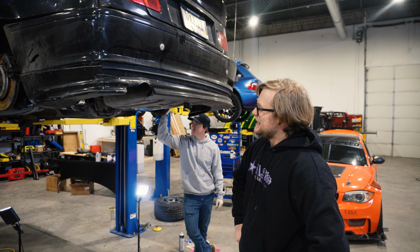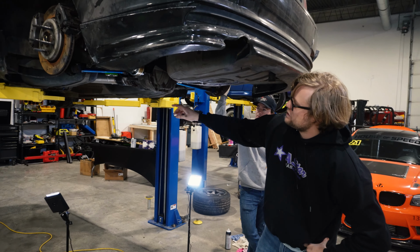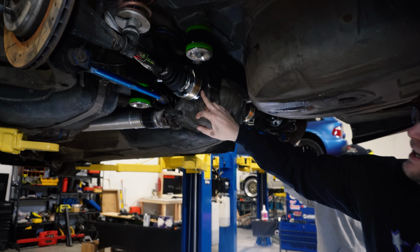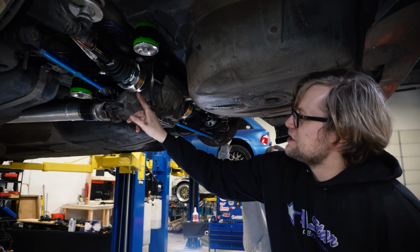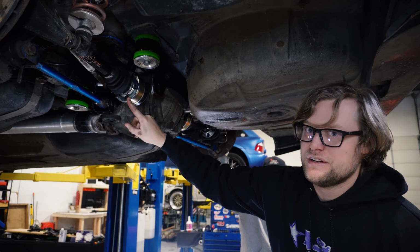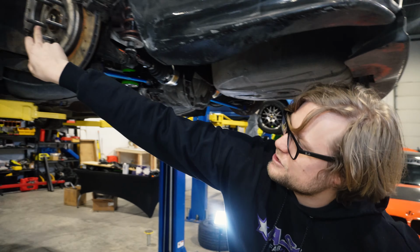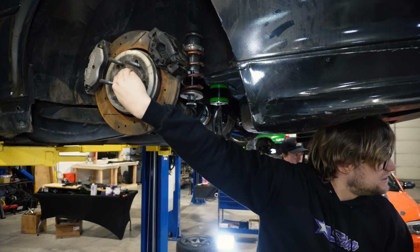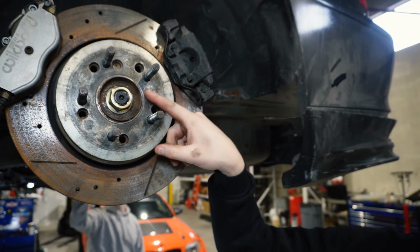So we're back the next day, and the axles are in. What we did was take the inner stubs off, but if you have the arms out, you can assemble the whole thing without removing them. To remove the studs, you're gonna want to torch them a little bit and impact them out. When you retighten these, you're gonna want to do 75 foot-pounds with red Loctite. And then I impact the outers on with red Loctite, but what was the torque spec, Sean? 216 foot-pounds.